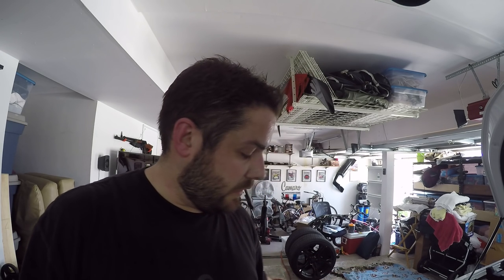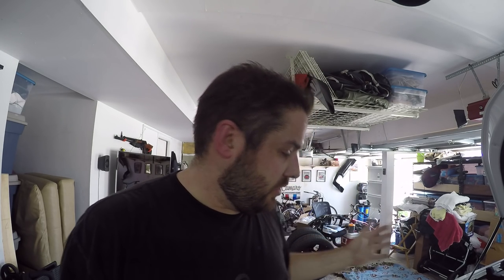Okay, so we've taken the bolts off the top here. We've taken the bolts off the passenger side underneath the wheel well. Again, there's those four bolts up top. Up inside, there's the three bolts on the corner where your hash mark is. And then there's a couple bolts underneath that you need to remove, and then obviously the bolts to even expose behind the padding or the dampening pad in the wheel well.